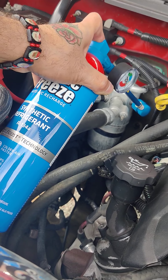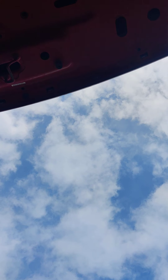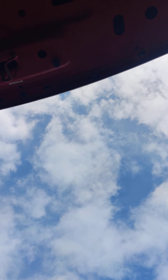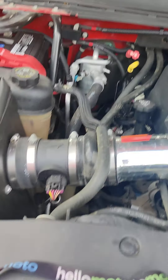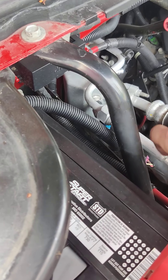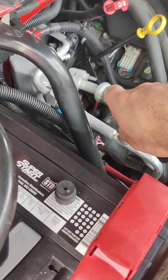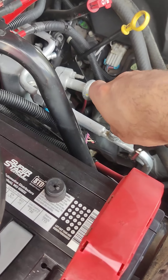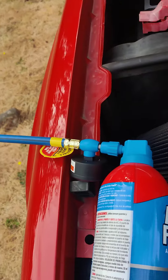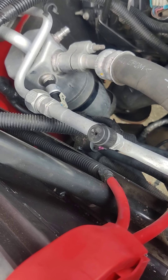They say you could add the full can, but my pressure is a little high so I'm not gonna add too much. Since my pressure was really high, I let some pressure out with my key on this valve — let some pressure out, there might be some Freon that squeezes out. There was a lot of pressure, so I let some of that out and then added some more Freon. Once that's back on nice and tight, I'm gonna add a bit more. I do hear a little hissing noise — that could be because the AC switch is not tight enough.